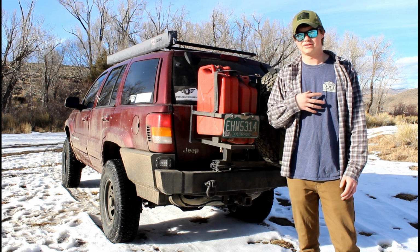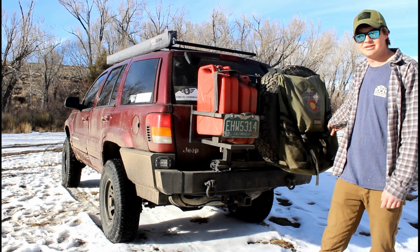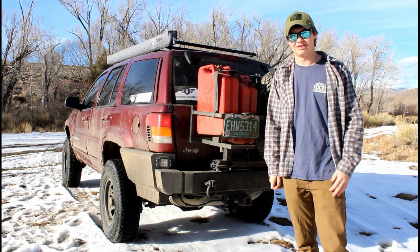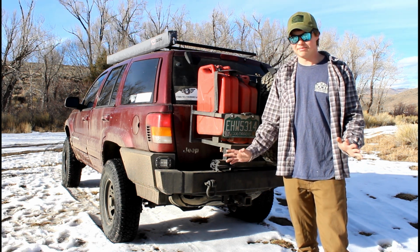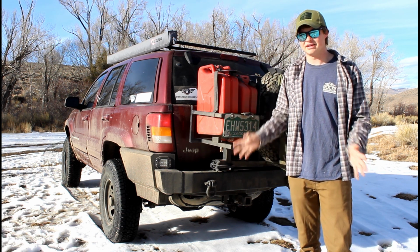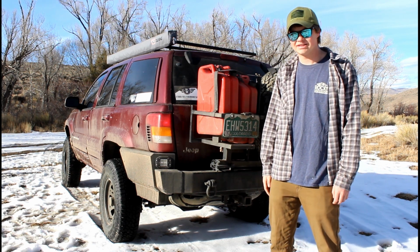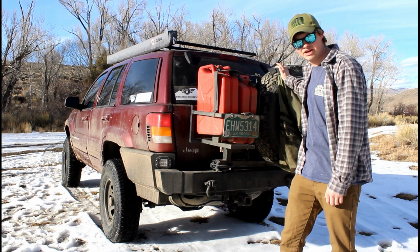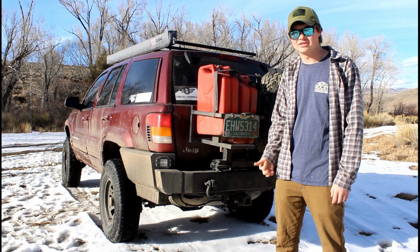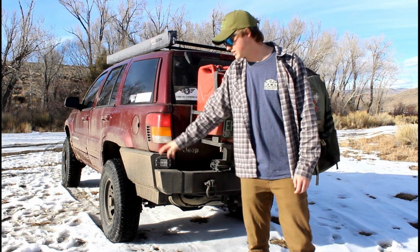I put it down to my fault, being that it's still a single carrier, and I actually had one of the bolts on the hinge break. The top sheared off. I was able to pull the bolt out, and I put in a stronger grade of bolt. I put that down to my fault, as I've added a lot of weight to this, and it was not originally designed to hold that much weight. The website, I believe, states you can hold up to a 35-inch tire on the standard mount. So you guys that want to run really big tires, this is a bumper that you can run, and it's a very cool design in that it's modular.